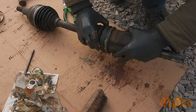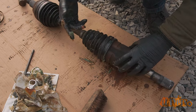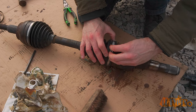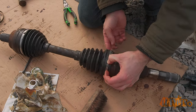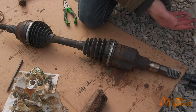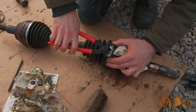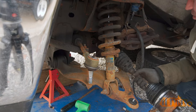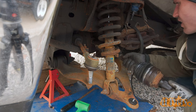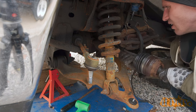Finally, put it back together. Wipe away any grease residue. Install the new band clamp — make sure it's as tight as possible before crimping the connection. Make sure that spline is clean before installing, then snap it back into place. You'll hear it lock into place and you can give it a pull test to ensure it is properly seated. Just make sure you pull at the housing and not further back on the axle.